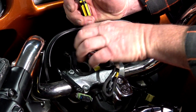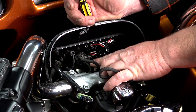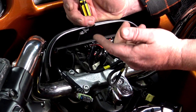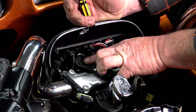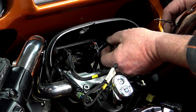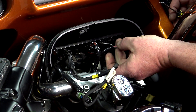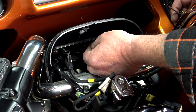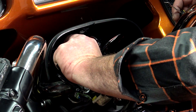This varies on different models — on some 2015 and older Road Glides this big clip will actually be one of the little bitty ones. Fortunately we've got the one with the big clip, and that big clip won't pull through the bar, so we'll have to de-pin it in a little bit. This is just a little tab you push up — if you have a hard time you can use your pick. Push up on the tab and pull that out. Get all three of those disconnected, plus your throttle-by-wire, which is just a big clip you push in and pull out.